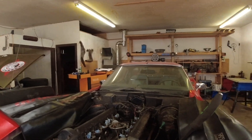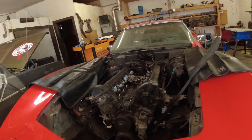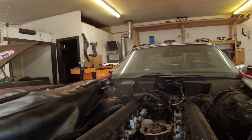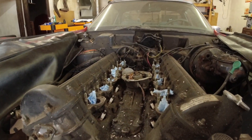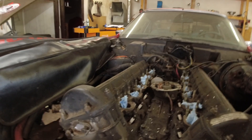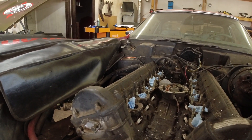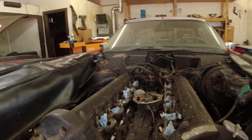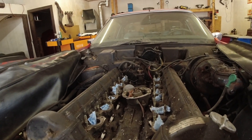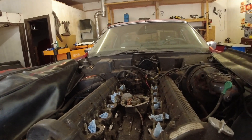So I figured I'm going to try and do something about it. It would have been a lot easier before we put this big engine in, but it's a good thing I didn't swap it before because I had to move so much stuff out of the way to fit this big engine. I'm going to convert the distributor over to a cam signal pickup and then 3D print — or get someone to 3D print — a really shallow cap for it, as short as I can go. And then we can start building the intake manifold as low as we can.